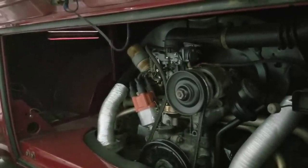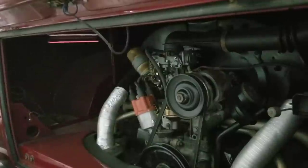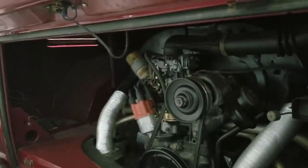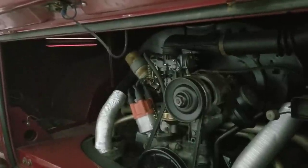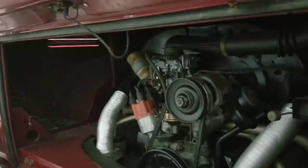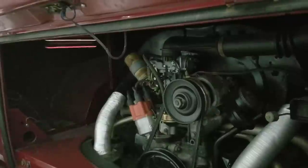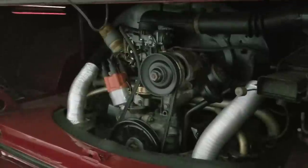You can still go with a stock carburetor. A lot of people say if you do all that you're going to have to go with dual carbs — no, you don't. You can still run a stock 30 or 34 and it'll actually run really strong, as long as you jet the carb right. My cousin had an 1835 in his bug and we ran that thing straight into the ground. It always had a stock carb, never had dual carbs, and it was really torquey and ran really nice.